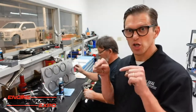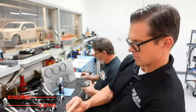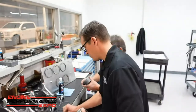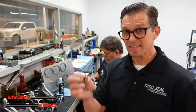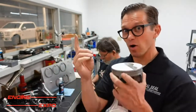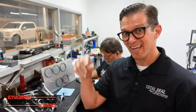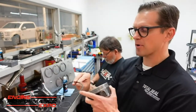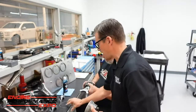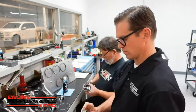If you ever have a question on a ring, usually the marking side is the up side — markings go up. If it's an inside bevel ring, on the top ring the bevel goes up; as a second ring the bevel goes down — you want the bevels apart from each other. This is a neutral ring but there is a Napier, so the Napier goes down. We also have a gas-ported top ring, and the gas ports go up — don't want gas ports down.